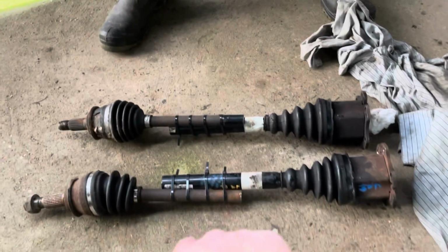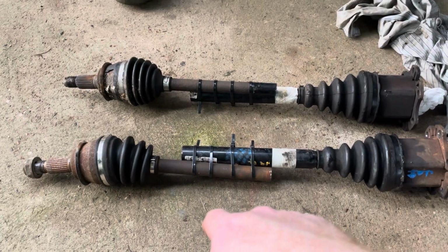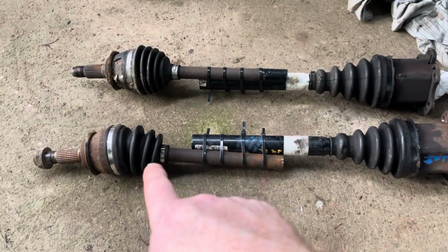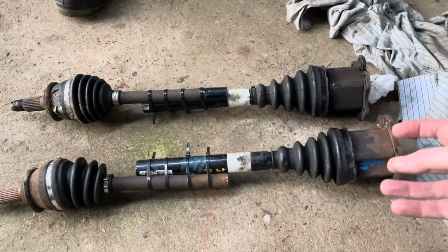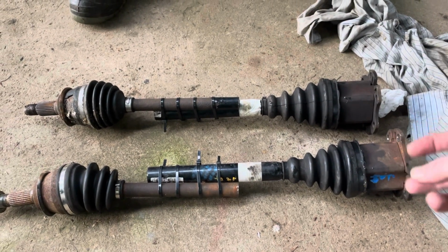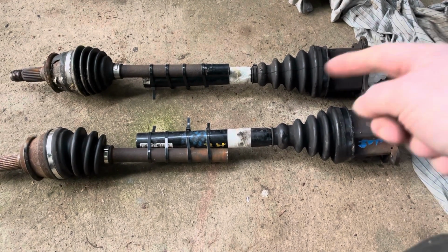So I think we should do two things here. Those joints can come off, can't they? Yeah, they should. Like snap rings, like the Minis. Then the little ones, and these pot joints come off, and then they've got the spider on the end with the three bearings. Again, there's mostly just a clip that holds that, like the Ford. We should maybe try and keep them just so I know which shaft is which.